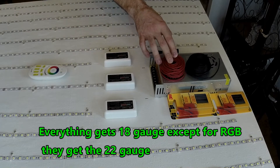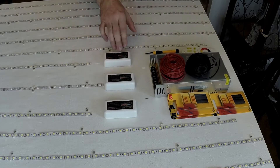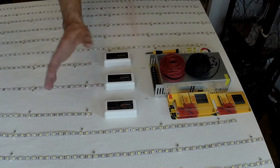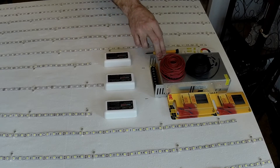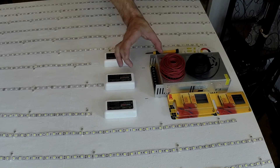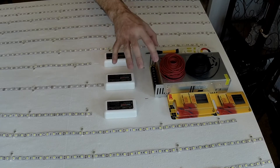This is based on research and kind of an educated guess about the wire size you need — it's going to vary from project to project. For just short runs, it's called chassis wiring. I'm actually going to have just a short amount of distance, so 18 gauge is way overkill for what I'm doing.